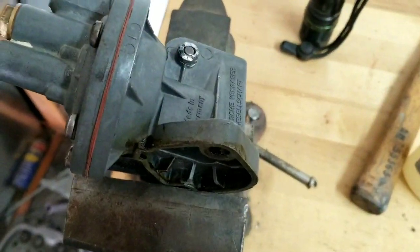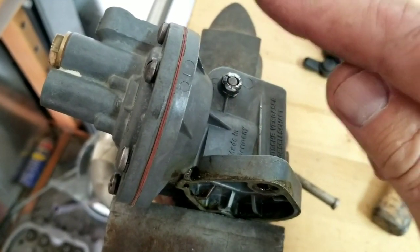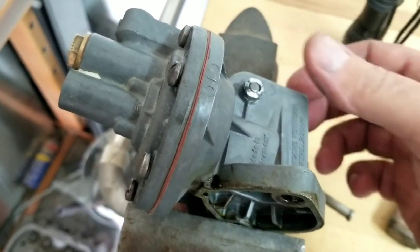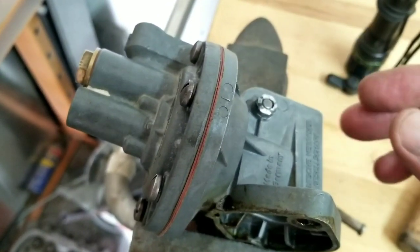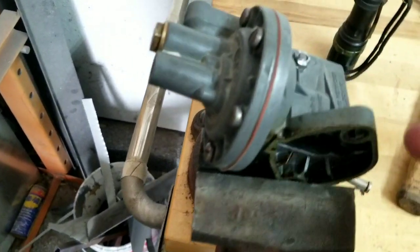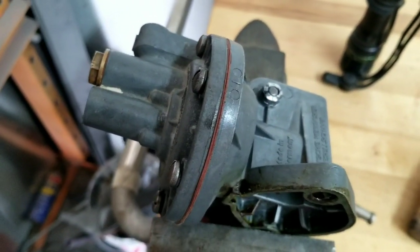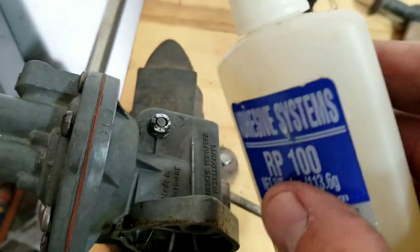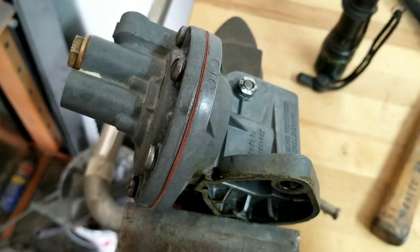To make sure that pin doesn't come out - if you have a 36 horsepower motor, I have no idea why they didn't put a pin with a stop on one end and a C-clip on the other, like a nut so it would just stay on, then a C-clip on the other side. The fact that this is made this way is kind of Mickey Mouse. VW did a lot of weird engineering things - some very good, some very poorly engineered, and this is one of them. I have no idea how long it's going to last, but do everything possible to make sure that pin doesn't come out - because if it does on the road, you won't be driving, and you certainly won't be fixing it on the side of the road.